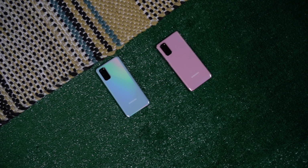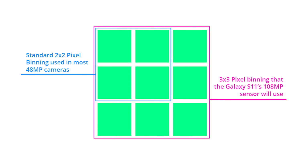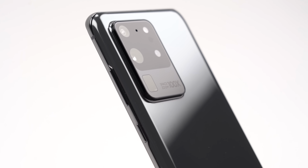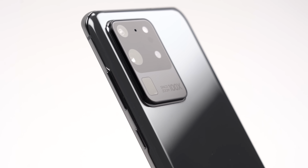They're using a process called pixel binning to now take 9 pixels and combine them into one, resulting in reduced noise and a huge improvement in low light photography from the previous model. There's also a new feature called multiple ISO composition that will allow a photo to be optimized depending on what's in it, like items or scenery or sky versus buildings, with up to a 6400 ISO. And again, we weren't allowed to take any photos and bring them back for comparison with this initial first look.